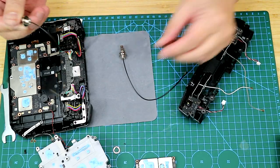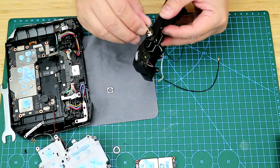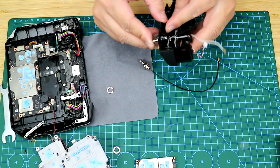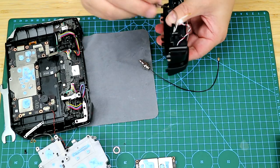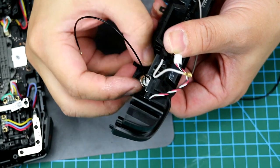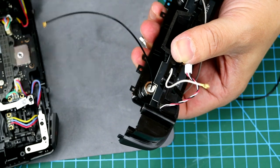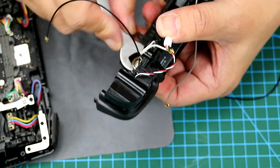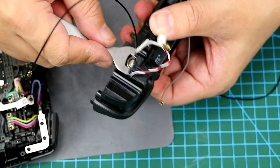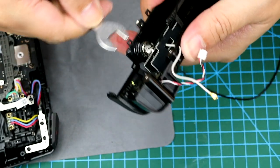And that is why they are really fragile and are unlike ordinary current conductive cables. So when installing the coaxial cables, we really need to be careful not to snap it, not to break it, not to damage it. And we need to use a wrench instead of nipper pliers. Squeezing of the cables may lead to poor signal transmission. So you really need to be careful here.